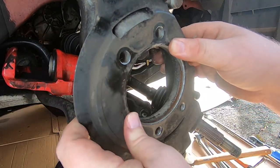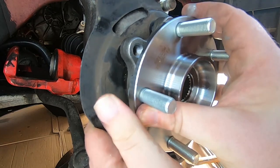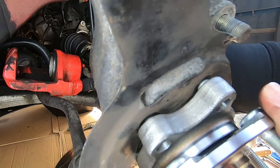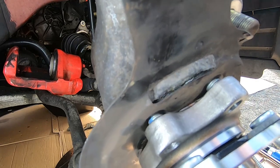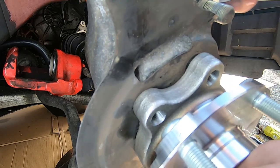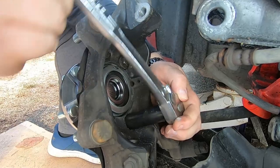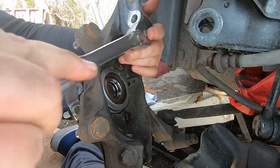Take note of the back plate — see how it goes back. That's to allow the rotor to go on there, so make sure you have it in that same orientation. If not, when you put your rotor on it's going to be rubbing on it. I couldn't get mine in all the way, so I started a couple bolts by hand at the top to at least hold the wheel bearing in place, then was able to put the other two in. Screw in each bolt a few turns at a time to pull the wheel bearing in by tightening those bolts.